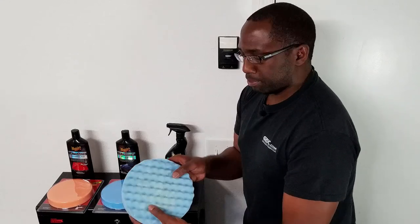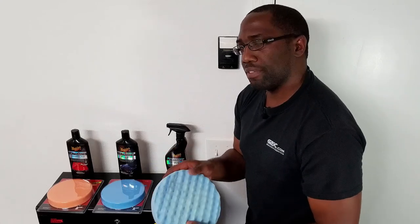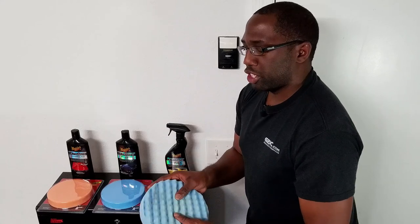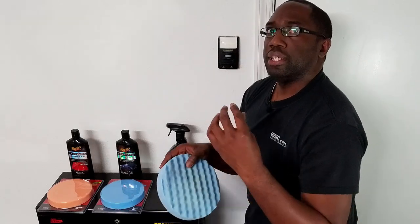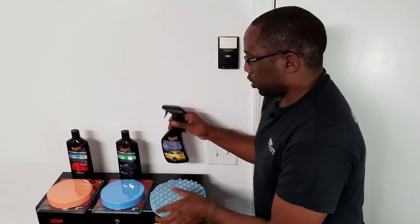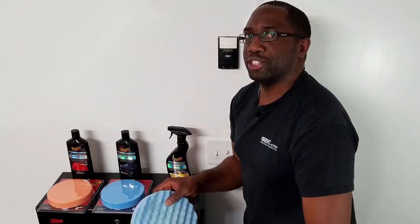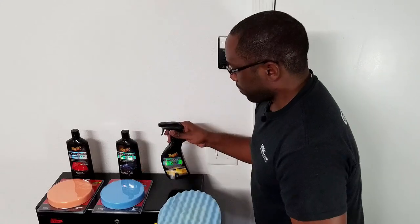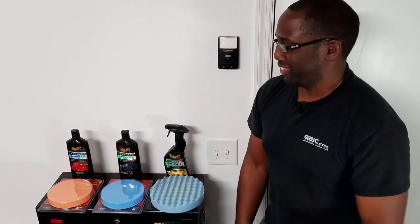And this one is a foam pad. This is actually my second time using it. There's a little bit of discoloration on here because I used this initially, but I don't really have a good feel for this pad yet. 3M makes really great products. They didn't sponsor this by any means, but you wanna have a finishing pad. This pad is really soft. And after all your polishing, this pad will remove even the slightest swirls. And you wanna also use a wax to actually protect the surface. So not only does it give you a nice, smooth, buttery surface, you also protect the surface with a wax as well. And you have different kinds of wax. This one is a quick wax from Meguiar's as well. And it works pretty well. So I'll be going in this process from left to right, and hopefully that works out. Let's get to the car and get started here and see if this actually works.